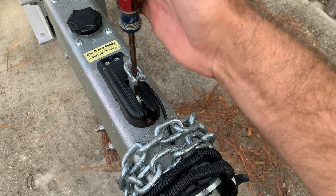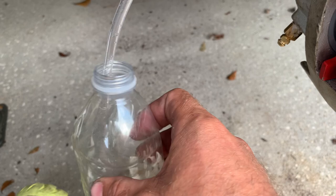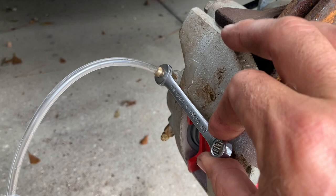Nikki's got pressure on the brakes. Now I've got to go back and open the bleeder valve. I've got my wrench on my bleeder valve and I put my piece of plastic tubing over the end of it. I'll take my plastic water bottle and stick the hose inside it. Nikki, you got pressure on that? Go ahead and crack my bleeder valve — see all that air pop out. Go ahead and pump it up and put pressure on it again.